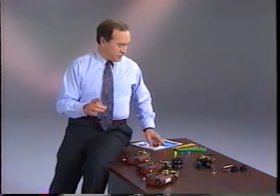It's very important to consider chamber size when selecting the slack adjuster part number from the part list. Four different actuator pistons are used to adjust air chamber stroke length. Generally, shorter length slack adjusters used with type 20 and smaller air chambers require red pistons. Yellow pistons are typically used for drive axle and trailer axle applications with drum brakes.